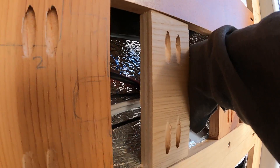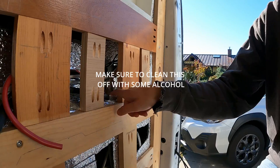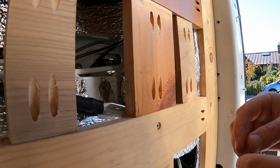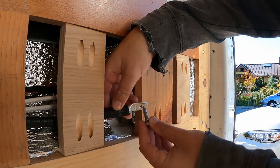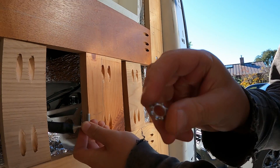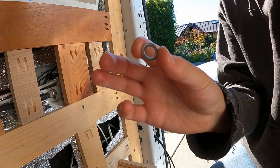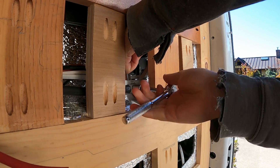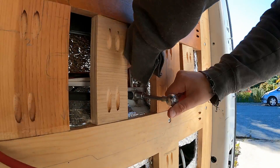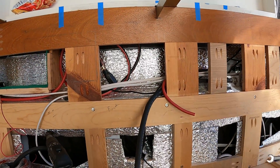Nico's about to make the hole for our chassis ground. There's already a hole here but we're just going to make it bigger and took some paint off so we get a good ground. We have a series of washers — we take our 5/16 stainless steel bolt, put a washer on, and put our lug through. We use a serrated lock washer on the back side, then a stainless washer, a split washer, and then a nut. There's our system ground — the wire will come out here and connect to our negative bus bar and our shunt.